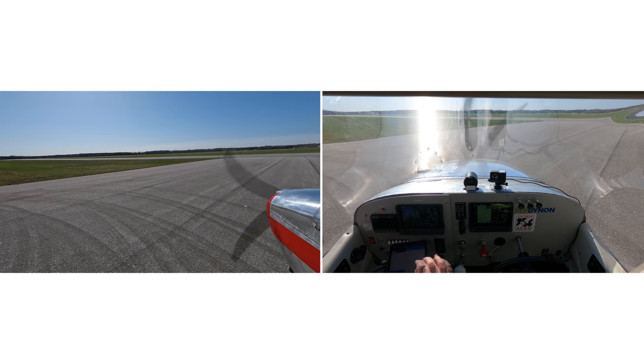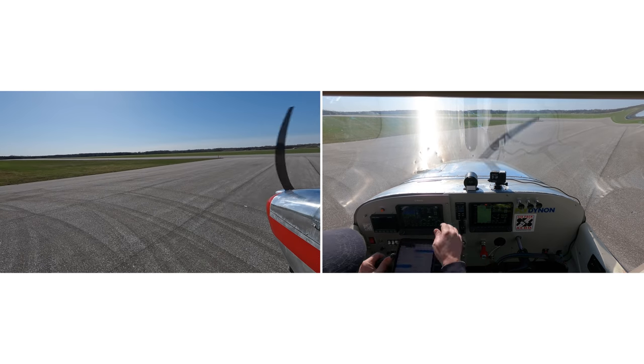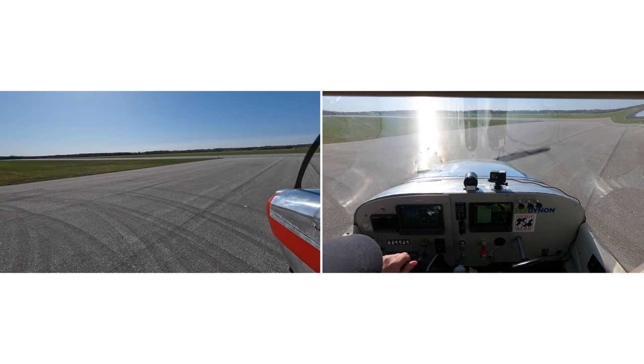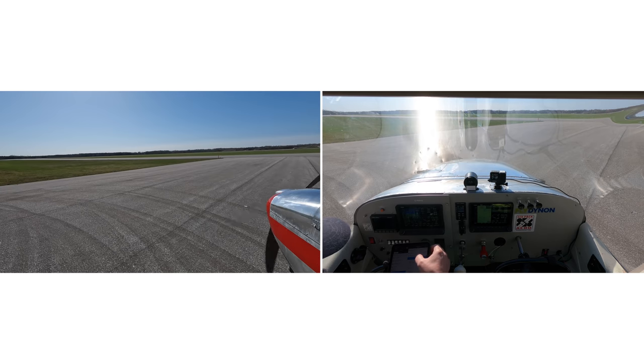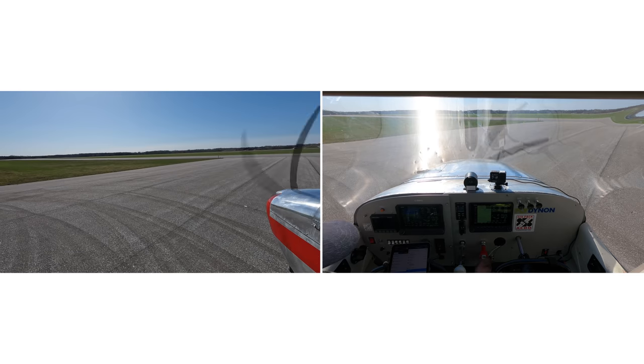There's our run-up. So, before takeoff, cabin doors, we're good. Flight controls, still free and correct. Just making sure that nothing's hitting on my lap or on the iPad, which can be a problem. Both. Rich. Trim. Flaps. Carb heat is off.